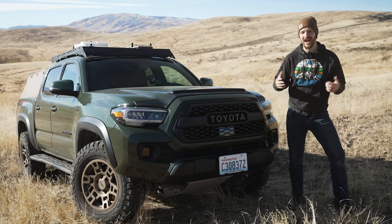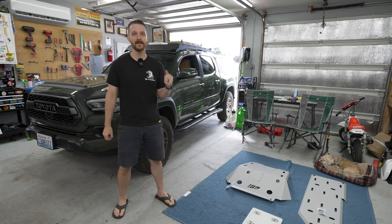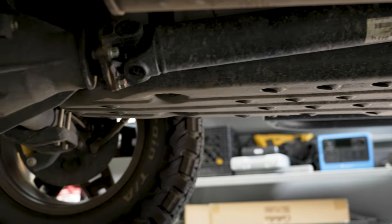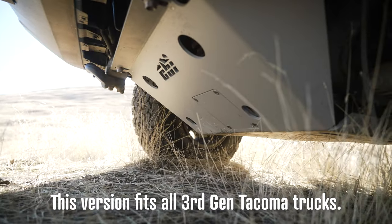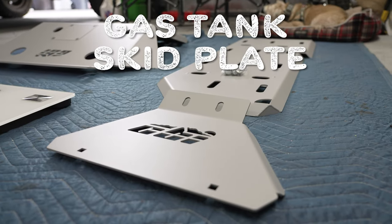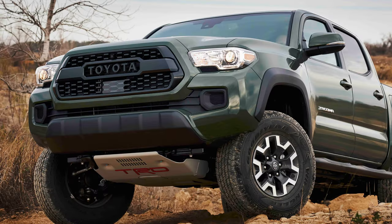So let's jump back to a much warmer time when these skids had no scratches. Now there's a decent thin but totally functional skid plate on the front. The gas tank is probably the most important upgrade — if you have to do just one, do the gas tank, because on the Tacoma it's actually plastic. The new front skid plate offers excellent protection and convenience with access doors so you can easily change your oil without removal. It's made out of quarter-inch thick aluminum to save weight, and steel is also available if max strength is important to you. The new gas tank skid plate is only offered in steel and there are different versions for short and long bed Tacomas. Both skids come in either a black or TRD gray powder coat finish — I personally love the TRD gray and how it matches factory skid plates.